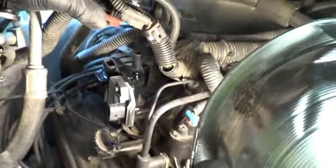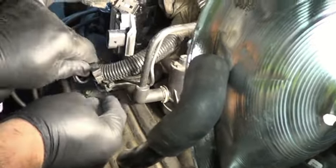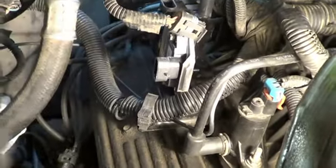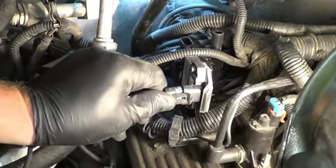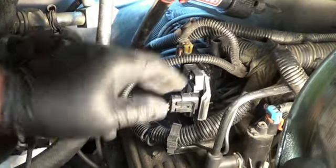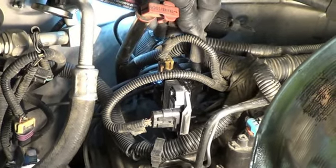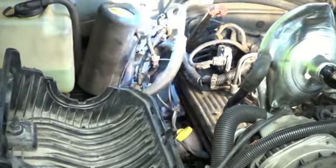We're ready to move this wiring harness back in place. Click that little clamp over that tubing over the wiring harness. And then plug in the ignition control module. Plug in the coil. Make sure they click there. There we go. And now we've got a coil wire. Alright, put some inlet air tube stuff back on, and that's basically it.